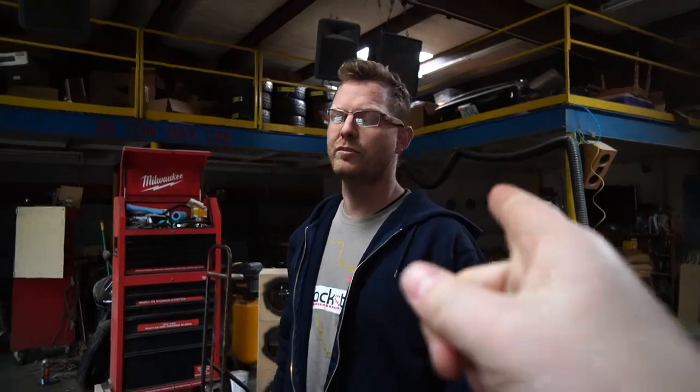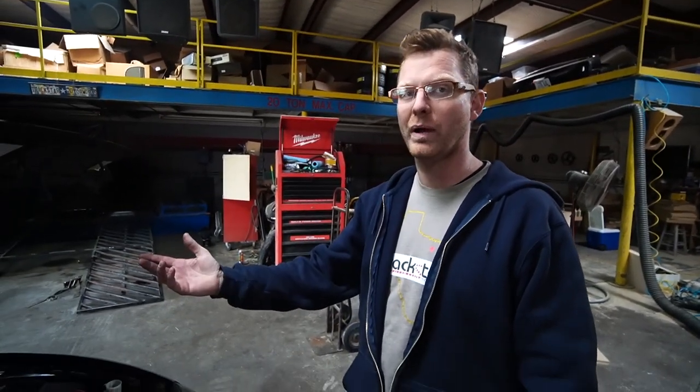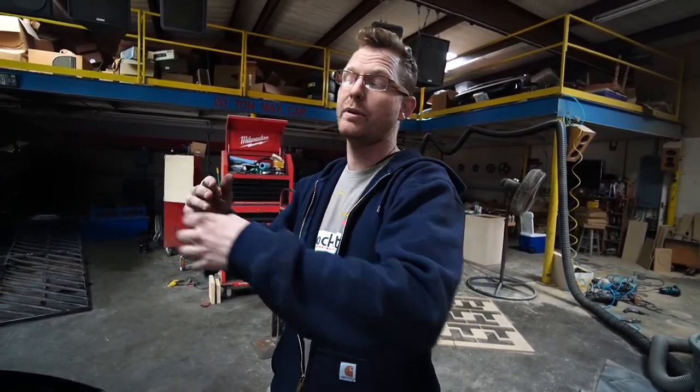Okay. Dilemma. So, the JDM car only has a map sensor. It does not have a MAF sensor. So the problem being that the map sensor here in this config is not ready for boost. So once it sees 0 pounds, it doesn't know where to go from there. A MAF sensor is not pressure based, so it doesn't know what's 0 pounds. It just sees more and more air, and until you get to the limit of the MAF, it's not a problem.